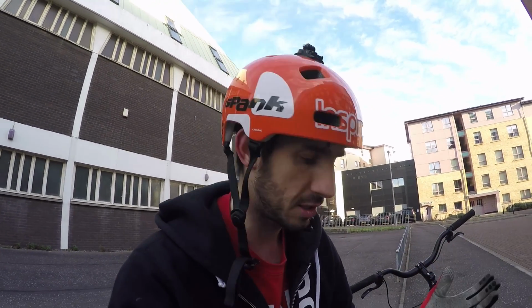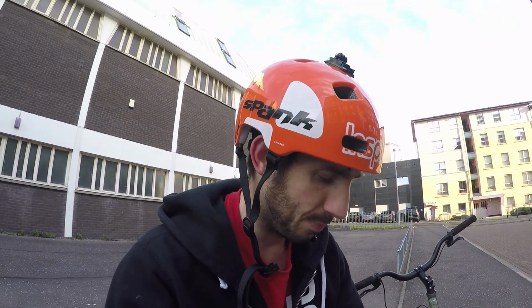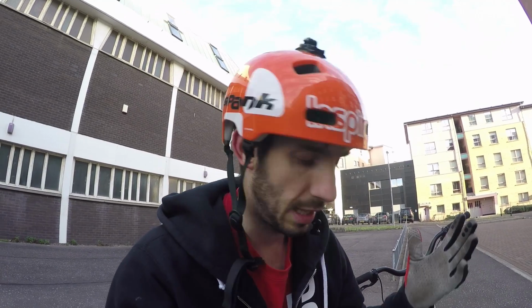Now I'm pretty sure if I went and did a spin, gap to 90 with narrow streety rims like these, the tyre's going to fold off and it is guaranteed to leak. So I think for streety trials, to be honest, you're not even going to want to run tyres this soft. But this system seems to work absolutely incredibly well. Just if I can stop it from losing air overnight or over a couple of days, that'd be ideal.